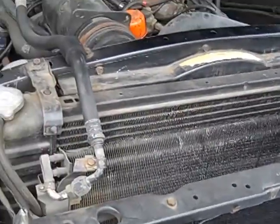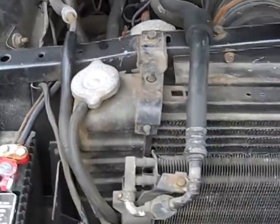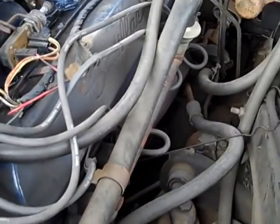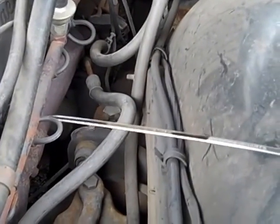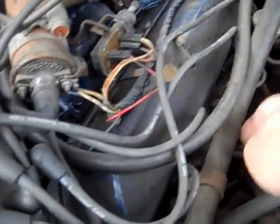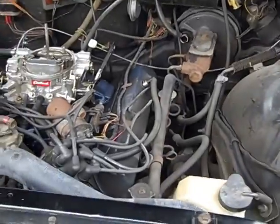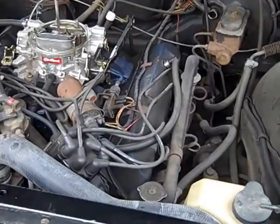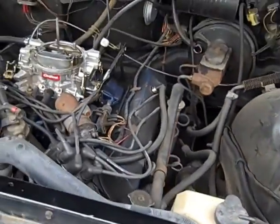Looking at things under here, of course I'd check the radiator and see how it looks inside that, and take a look at the oil. Something that happens on the 429 engines is the dipstick will break off. That's on an engine that's had a miss or shaken a little bit, causes extra vibration, been running low on oil, and it'll usually eventually break the tip of the dipstick off, and it'll be laying in the pan. So on any 429s, pull the dipstick out and look at it.